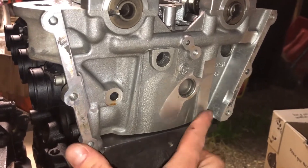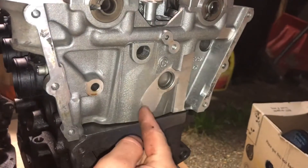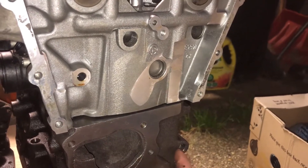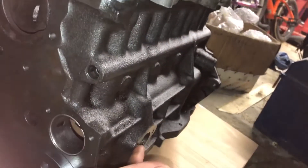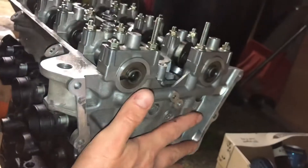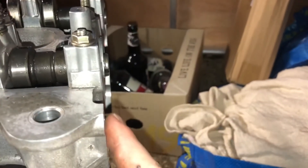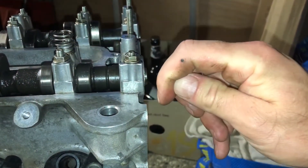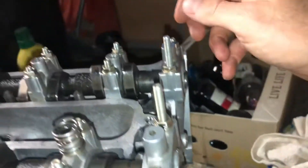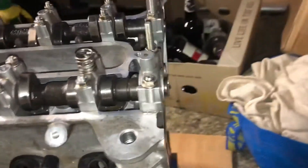On the Mini block you get an aluminium fillet piece, weld it in here — it seals off that part of the block. You have a plate on here with an oil drain that I'm probably going to run into this tube or down to the fuel pump hole on the back. That plate is at the machine shop because I'm getting the rocker cover cut back. The Force Racing cover allows the rocker cover to sit 5mm beyond the edge here, giving you a lip to seal up and over — whereas the Specialist Components one has a bit of metal riveted on at the back. I prefer the Force Racing idea so I went with that.